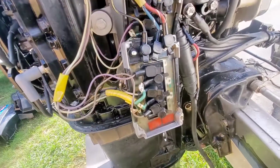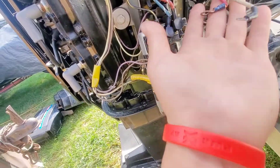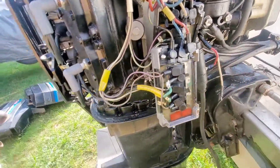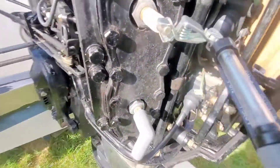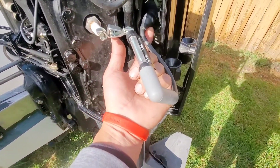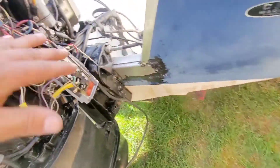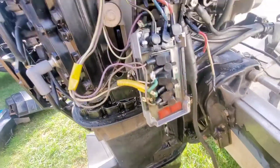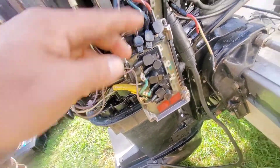So now I'm starting to get a little frustrated. I disconnected the bias wire, and I also took off the idle stabilizer — I'm unplugging everything. But I got spark on all cylinders except number four. So I'm going to test this coil and make sure it's reading the resistance it needs to. The trigger's good, there are brand new switch boxes, everything's been connected. Now I got spark on cylinder number one without the bias wire, so I'm going to have to look into that. I'll test this coil and get back to you guys.